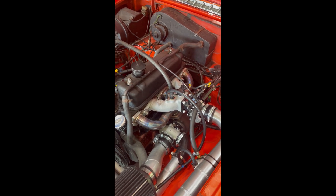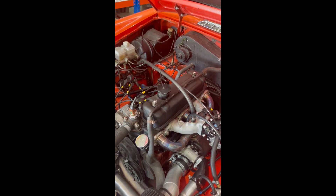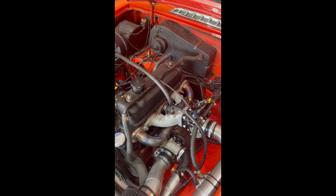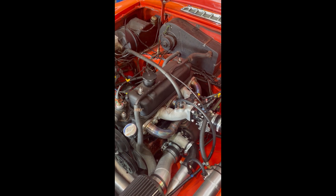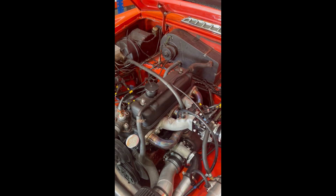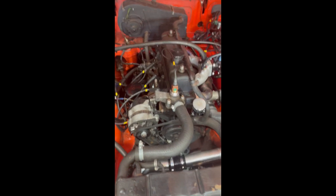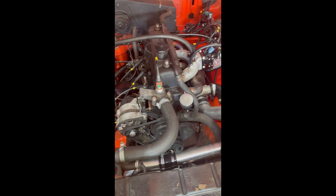That's with a standard head gasket and no decompression — nothing changed. If you follow our A-series adventures, on the supercharged Rotrex A-series we run just over 10:1 compression because we have the same injection system and intercooling — you can control the spark and have nice cold air coming in. Adding decompression plates on the B-series loses what it needs: the piston close to top dead centre generates squish, forcing the mixture into the chamber to burn it. The turbo kit just acts like a power adder. It spent a few days on the dyno, behaved perfectly, and drives and cruises lovely.